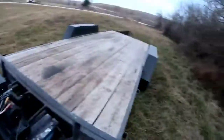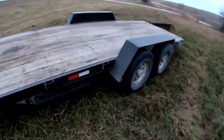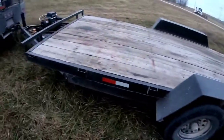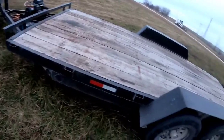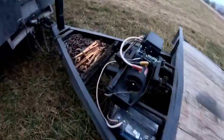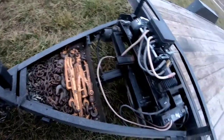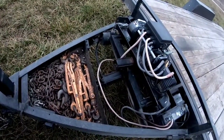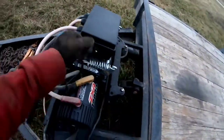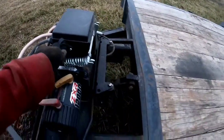This is my 18 foot H&H tilt trailer that was a car trailer. I put eight lug axles underneath it, added more pieces of c-channel, mounted a winch on it, put an electric pump on it, and a chain basket. It's been modified quite a few times. I've had this since probably 07 and it'll never leave — it's the one piece of equipment I will never sell.